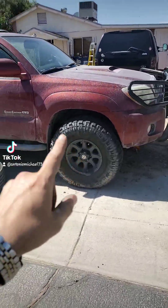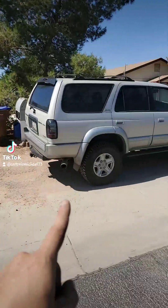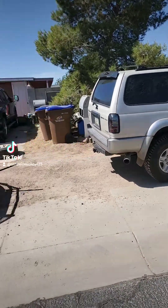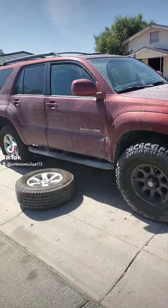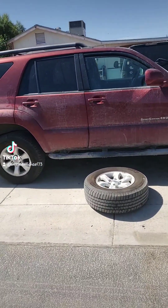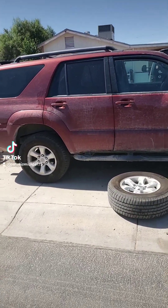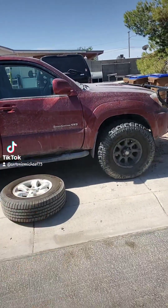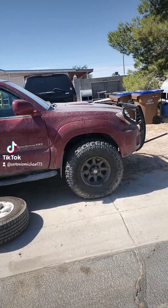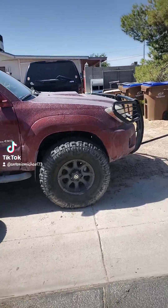But if these tires barely fit and you can't really turn, Rose's tires will definitely fit. You don't need the spacers for the rear because the calipers in the rear are smaller, so you could put 16-inch wheels and clear the calipers perfectly fine. On the front, you can't clear the calipers with 16s because they're bigger calipers, so you would have to install the 2-inch spacers, which I put on both sides.